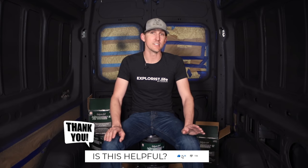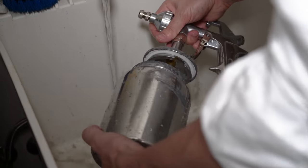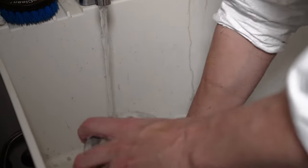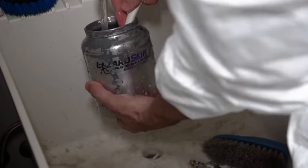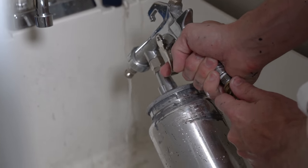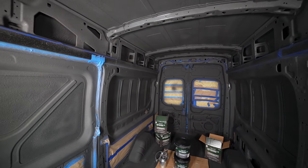The next day I followed the exact same steps for the second coat, then cleaned up the spray gun by disassembling everything that could be disassembled, scrubbed all the Lizard Skin off the sprayer, sprayed some warm water through it, and set it out to air dry. The following day, after the second coat dried, here's how it turned out.